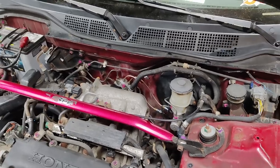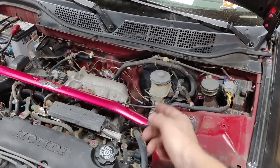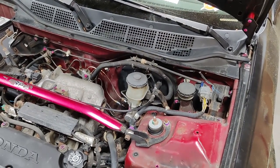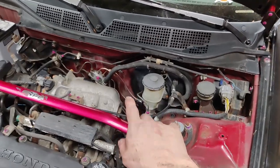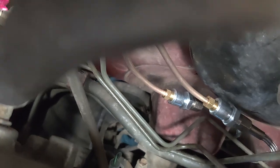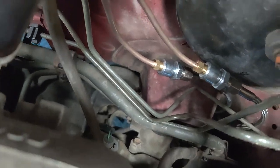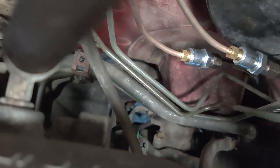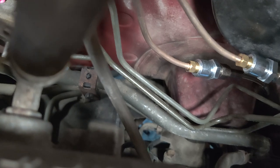One of the first issues I had to tackle was actually one I created myself. I've had to redo these lines before — not the whole lines, but just where they come through the subframe and the body going towards the rear. The previous owner patched the line with a compression fitting, which is not the way to do it. What I did when I fixed it was send the lines down near the steering rack, but in reality they're supposed to go between the body and the subframe. The problem is it was going through the subframe, so if the subframe ever needs to come down I'd have to undo the brake lines.